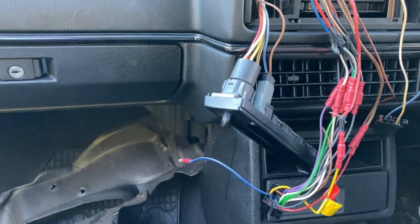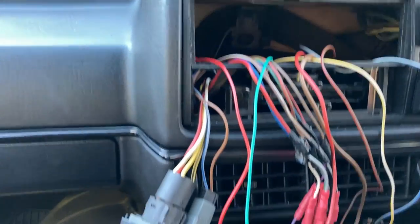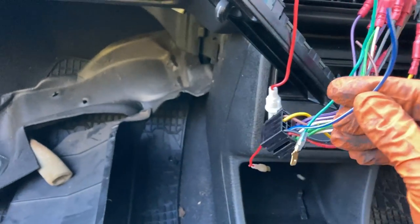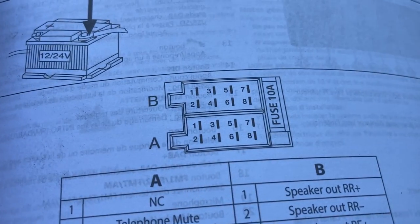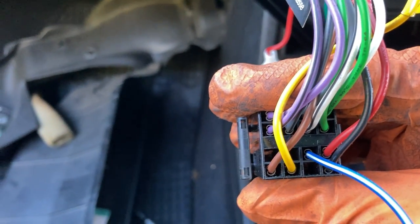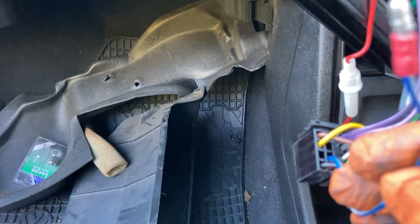In the heater aperture are the two power leads from the antenna — it was really easy to feed them through a hole in the bulkhead behind the cabin air box and pull them through. The antenna coaxial is here as well and it's only just long enough — it's going to be pretty tight. I need to work out where the permanent live is going to come from and the power from the radio. As I said before, I think it had a power antenna before, and this looks like it would have been used to power it. Looking in the Blaupunkt manual, pin number 5 is auto antenna — the blue and white wire is one up from the bottom of the three across on the ISO plug. So that's definitely going to connect to the Blaupunkt's aerial feed — and it's ISO standard so every stereo should have this on the same pin.